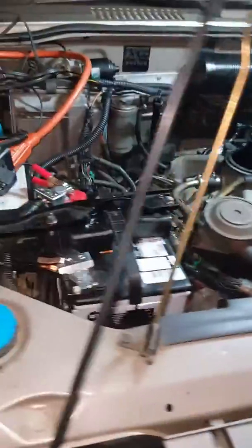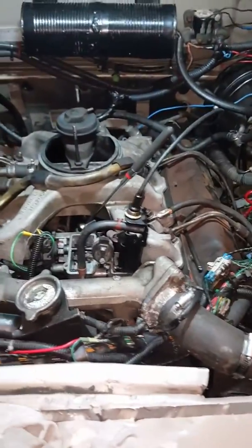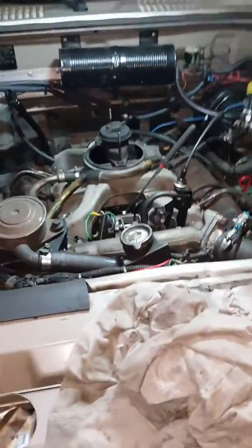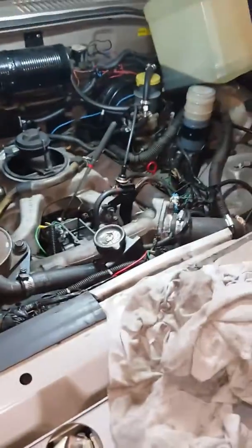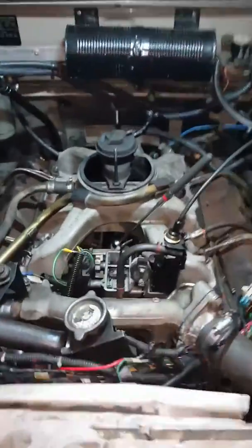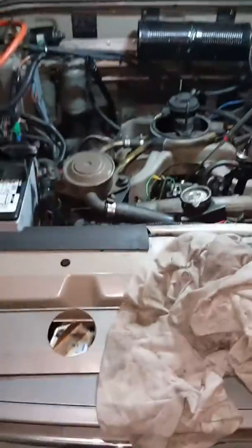I did one last test and I was about 19.7 miles per gallon. That's not bad. That's measuring the fuel out of the tank, measuring the mileage per GPS, so I would assume that's about as accurate as you can get. That 19.7 was with the 430 final drive gear, which is a tall gear, averaging 62 to 63 miles an hour. A couple times I've had it wide open, about 5-6 times going up hills just to clear it out a little bit. And that's what I've been averaging. So I should be able to get better.